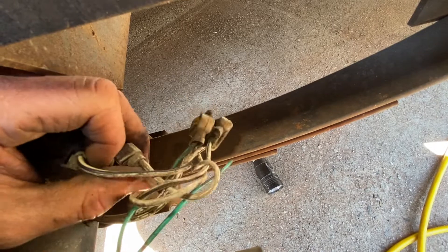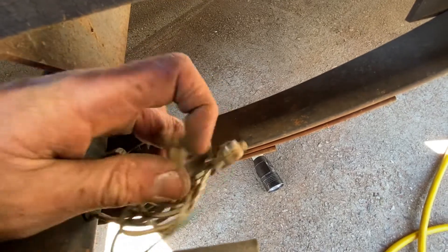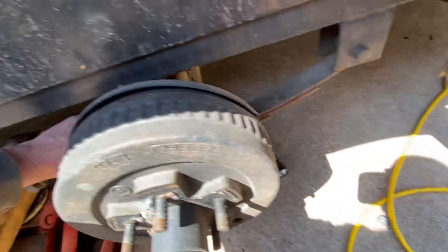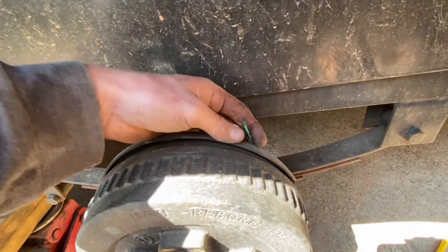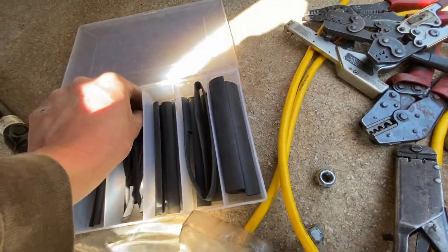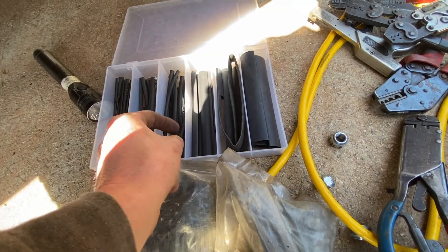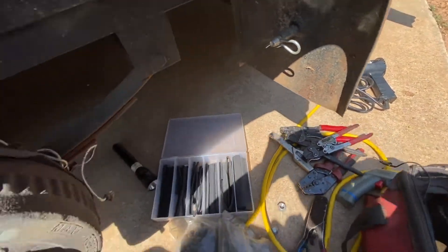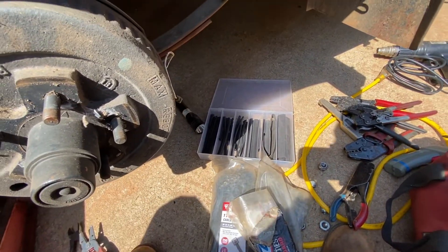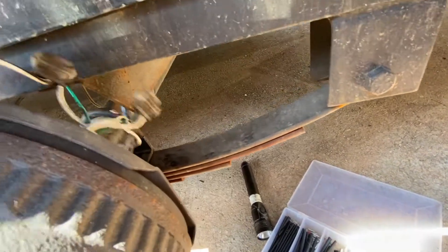I just need to keep it separated so we don't have to figure that out later. We also have to go to the other side because it's almost broken off — actually, the scotch lock is totally missing, it just fell off completely. Here's our arsenal: I use these heat shrink crimps. I'll use a yellow version and put heat shrink over it — makes it nice and streamlined. We have our heat gun, a pair of dykes, some strippers, and I'll work around not having my favorite crimping tool.